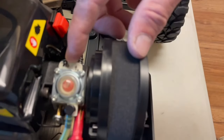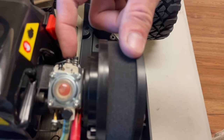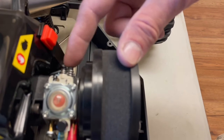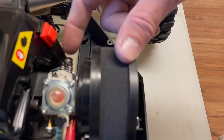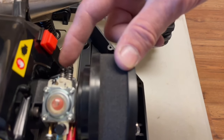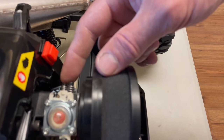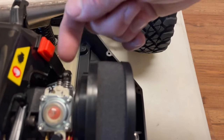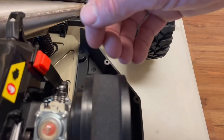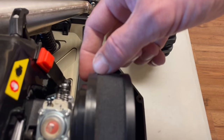From a distance you can see an H and an L — that's your high speed and low speed jet. Once it's broken in, that's when you can start playing with it. Turn these in and you're leaning the motor out — making it leaner. Or you can richen it up by bringing the jets out, which makes your mixture fatter. You want to do about a sixteenth of a turn at a time when adjusting.